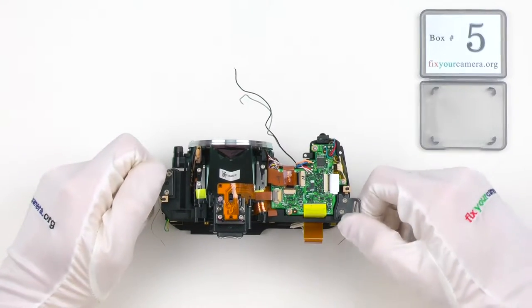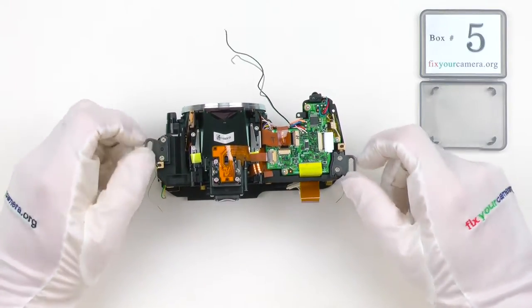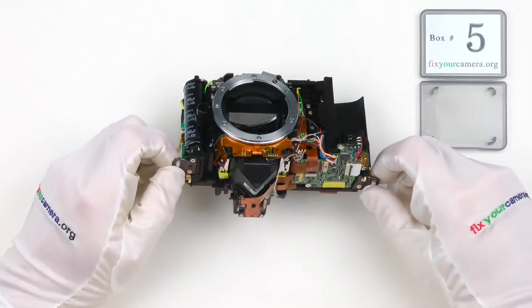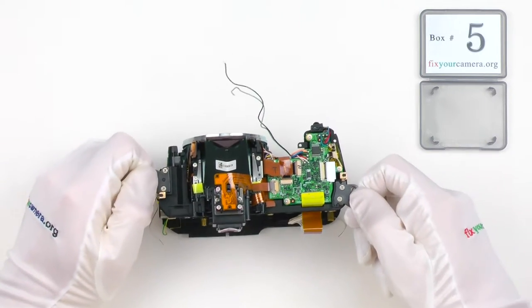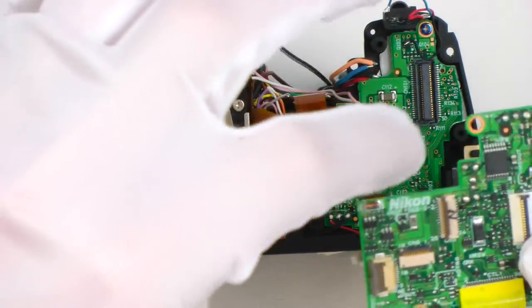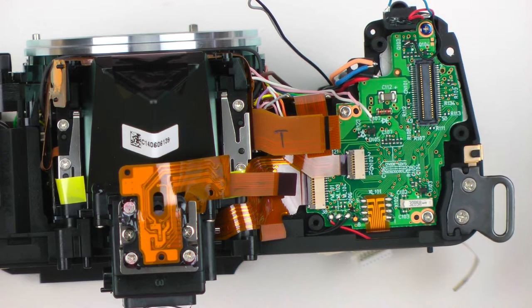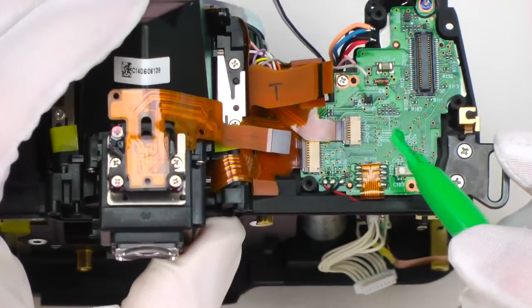Now the top part. Every DSLR, when you remove the covers, has two major parts: the rear body or mainframe, and the front body or mirror box. All of the mechanical stuff is going on within the mirror box or the front body, and most mechanical failures are within this part. In order to remove it, I have to remove all of this other stuff first. Now the mainboard — this is the part that controls all the functions within your camera, like all or most of the buttons, and drives the motors. No heavy digital image processing is happening here.